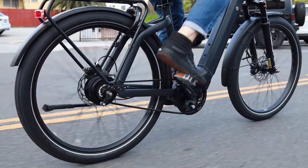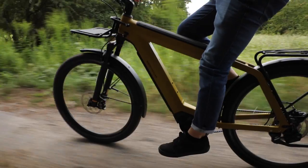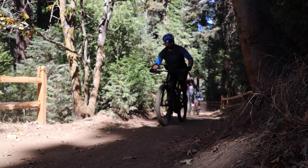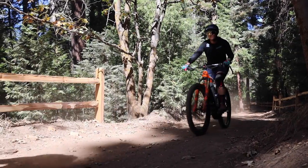For those who want a really low maintenance bike — just set it and forget it — the Enviolo hub is a great way to go. For those who want low maintenance but also a bit more performance, the Rohloff is a great option, but keep in mind you'll spend significantly more money for that. For terrain, if you're riding a mountain bike you're generally going to use a traditional derailleur, though Rohloff hubs are becoming more common on mountain bikes. Enviolo you won't find as much in off-road scenarios — it may not be as efficient and the shifting experience is a little different.